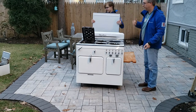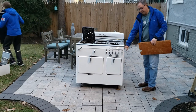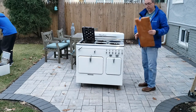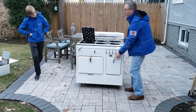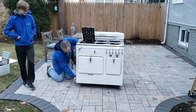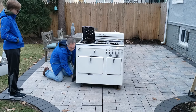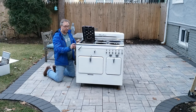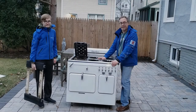All you have to do is lift them up and then move them safely away. Sometimes this insulation is adhered to the side of the stove, sometimes it's not. If it comes loose, just stick it in here and you can get to it later. Do the same thing on the other side. You can see this one's still stuck on — no need to take it off. Now that the side panels are off, the next thing to do is get the legs off.